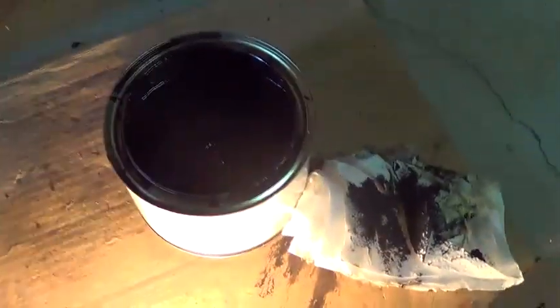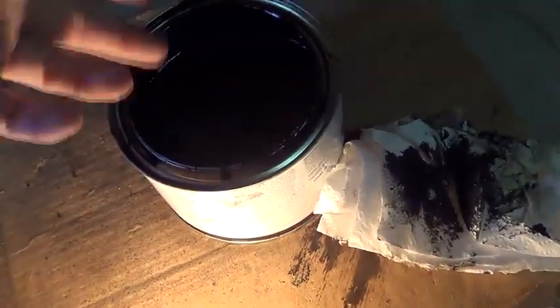Well, I get down here, and I started to do underneath in my outer tub in the wheels, and on the other side, it would be easier to show you, like here, it was kind of coming out like this, and I was trying to blotch, and I'm like, I think it's supposed to look a little more bed linerish, you know what I mean, like that kind of textured look. And darn it, if I didn't forget to stir it. I completely forgot to stir it, so I've just been taking the stuff off the top. Just now, I got it stirred together, and now I'm getting that real nice looking texture.